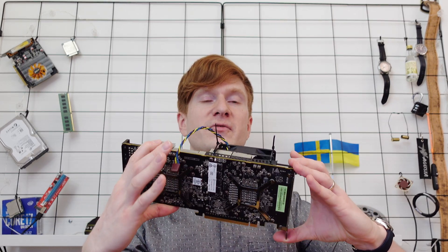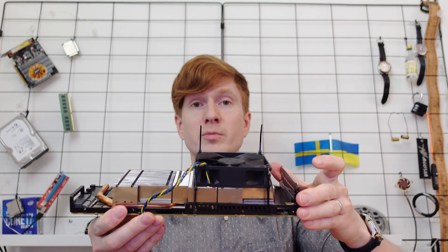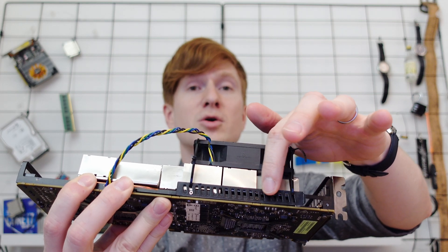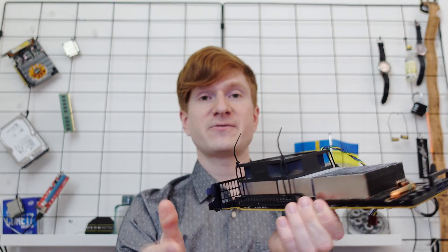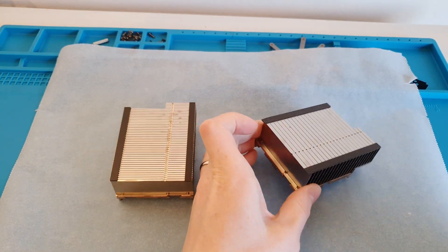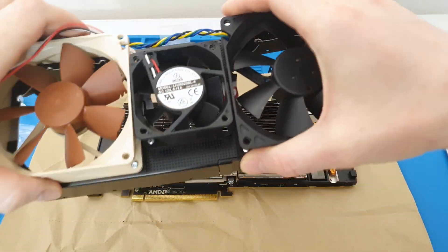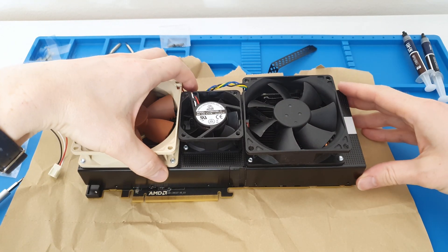A configuration with a very fast server fan works well and keeps the graphics card at normal operating temperatures. I used the shroud screws to mount a small bar, then used zip ties to attach the fan straight onto the radiator, so the air blown by the fan has no option but to go through the radiator and cool the GPU. It's also important to note that the GPU heat sinks are not identical — one has more fins than the other, designed for efficient airflow in a server chassis. When using fans on top of the radiator, I recommend placing the heat sink with more fins on the main GPU.